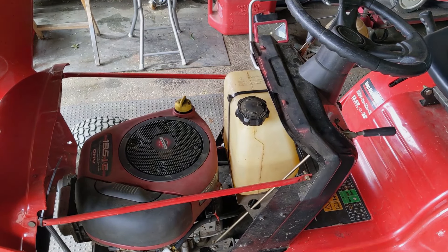You'll notice that the riding lawnmower looks fairly clean — that's because this mower has already been fully serviced. I've gone ahead and replaced the fuel filter, changed the oil and the air filter, as well as cleaned the top and bottom of the deck. I'd like to show you a photo of how much grass we took off this riding lawnmower — all of that is dry grass. As I recommend to my customers, cutting in the dry is one of the best things you can do, but you have to clean off the lawnmower with an air compressor or pull out the clumps of dried grass by hand.